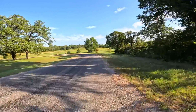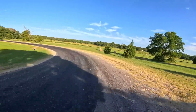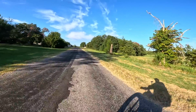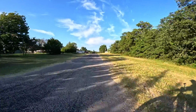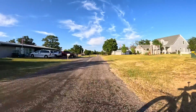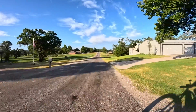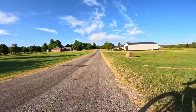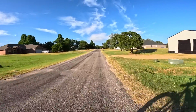On a bike that does not have a torque sensor, that's not the case. You get up to about 15 miles an hour and you really start pedaling, you get nothing. It doesn't even feel like you're pedaling. It's like you're pedaling thin air and your feet feel like they're gonna slip off the pedals. And it can be an uncomfortable situation at those speeds. But with a torque sensor, even right now I'm doing 18, 19, 20, and I'm pedaling, and it still feels like there's torque, there's tension there, something for me to pedal on. I'm telling you, it makes all the difference in the world.